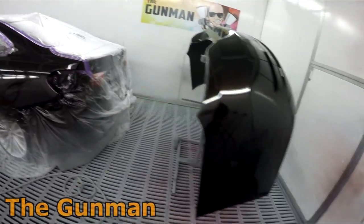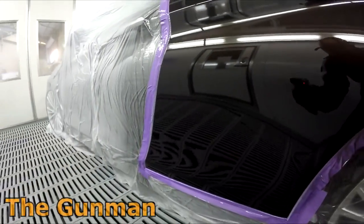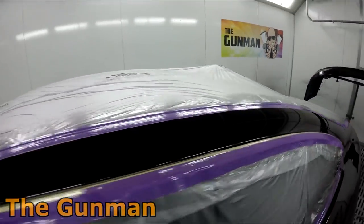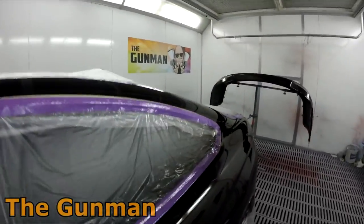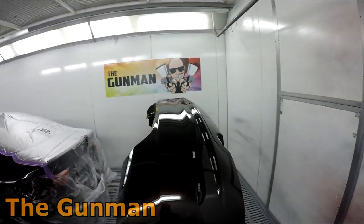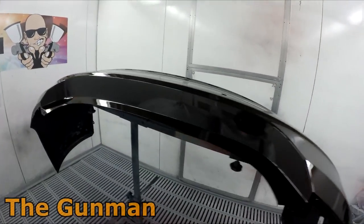17 years in the trade and I'm still excited once I'm smashing a nice coat of clear on. Still love this. So you've probably noticed that I did the half coat, wet coat style application — tack and whack, grip and rip, call it what you will. That's with the Standox Standard Clear, and I just put one coat on, bang, straight away, put your next coat on, job done. I'm using the VOC hardener in it — it's quite a good quality clear. I've really been enjoying it. We used to use the Crystal Clear, but yeah, really enjoying using this Standard Clear.